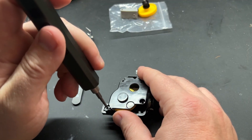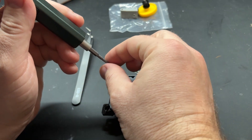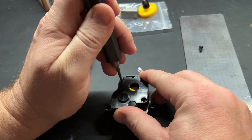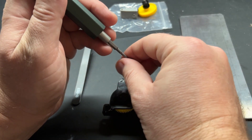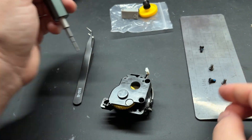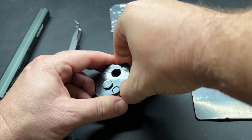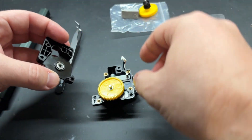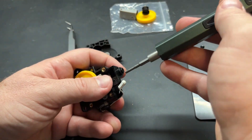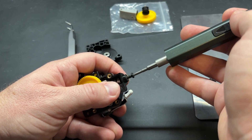There are four screws that hold the top shell in place and we can begin by removing these. I have a little magnetic mat which is really handy for making sure screws don't fall away and get lost. So carefully remove all the screws and put them to the side. Then gently pull the top plate up and it should release itself — it may require a little wriggling to get it free. You can also see the bearing that's in that top plate, so make sure you don't lose it. Before continuing, loosen the screw at the top to loosen the spring, allowing the active gear to move more freely.